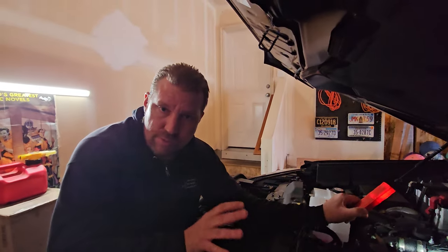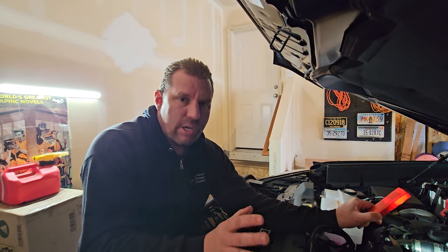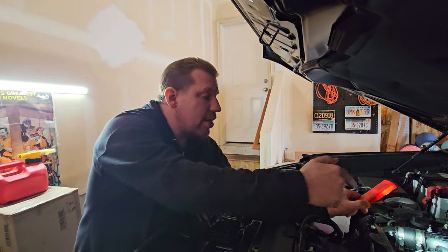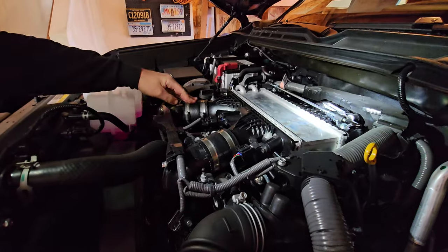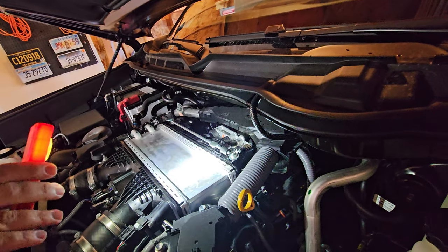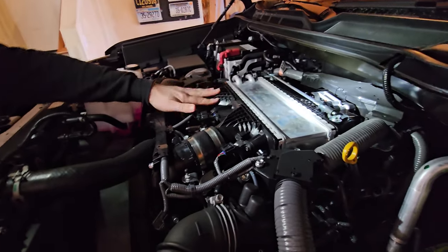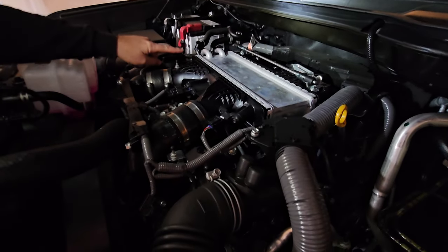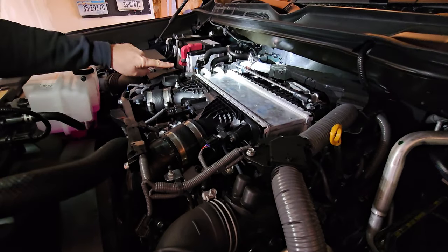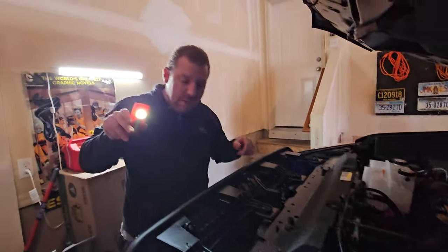This is very different from the EcoBoost from Ford. Ford uses an air-to-air intercooler on both the 2.7 twin turbo, the 3.0, and the 3.5 — whether it be the high output like on the Raptor or not. On Toyota though, they use an air-to-water intercooler mounted right on top of the engine. Both airstreams go right into this air-to-water intercooler, then it comes out into a throttle body on the backside of the intake, and the intake is pretty much underneath this air-to-water intercooler. The intercooler has its own water pump and cooler lines that run up to two different radiators.